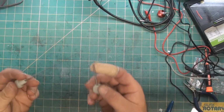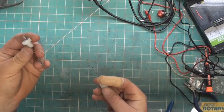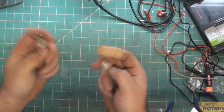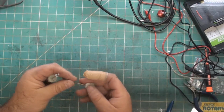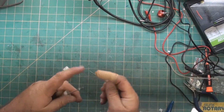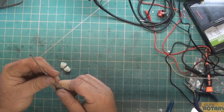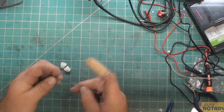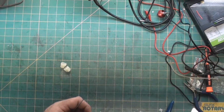Here is the flexible drive unit from the Mad Pumpkin Patch, sorry. The drive shafts have snapped clean in half. Been looking around for a new drive shaft, haven't been able to find one. So, you can't really fix this one. Welding spring doesn't work so well. If you weld it, you got a point that's going to stretch and it's going to break on one side of the weld or the other.